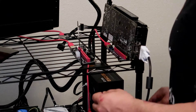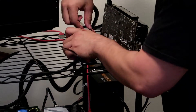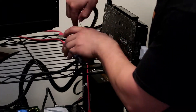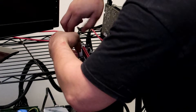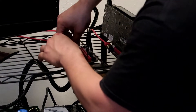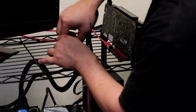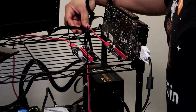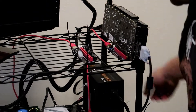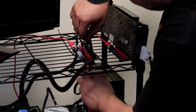Let's zip down this PCIe riser. I'm going to use a SATA input to power it on the back. Normally when you get a power supply, you'll have three SATA outputs per wire. I like to only use two, because you can draw too much power from one cable and end up burning out the cable itself. I normally run about two risers off one cable. I'm only going to use one here — the other will just be there — because this draws too much power and you don't want to burn out your GPUs.